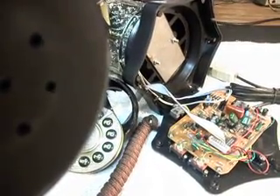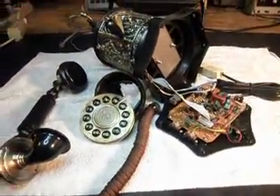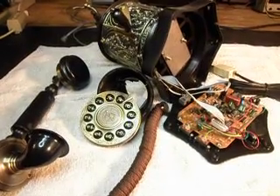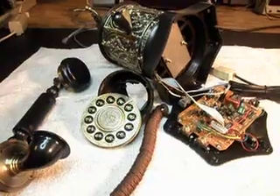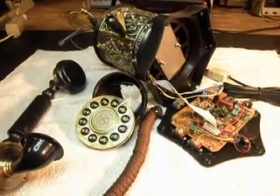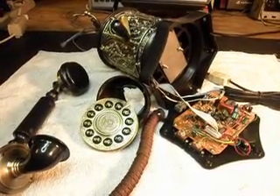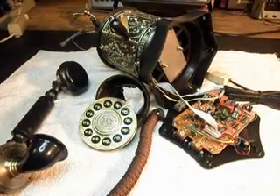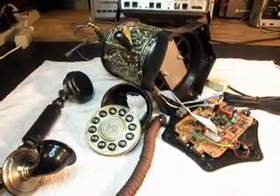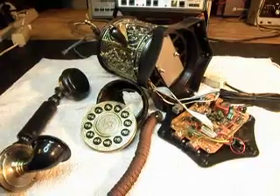Today is Tuesday, February 22nd. We know the telephone works now. I'll do some final checks on the telephone. The telephone is repaired, and it looks like the only problem was one single wire on the keypad board — probably what you would call the independent ground for the IC chip and for the keypad for 1, 2, and 3. This is Dennis with A1 Telephone Service and Repair, A1 Electronics. You can reach us at www.a1-telephone.com and at 618-235-6959. Thank you for watching, and have a great day.